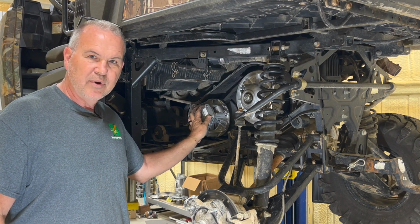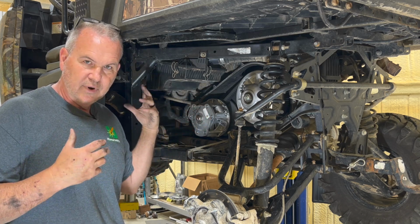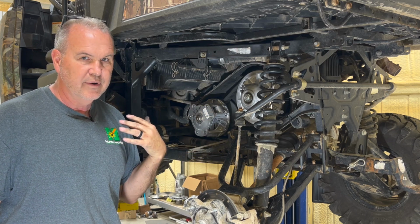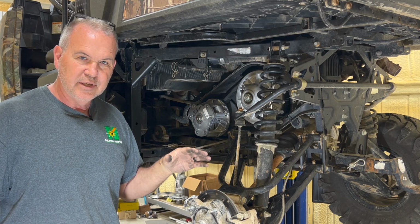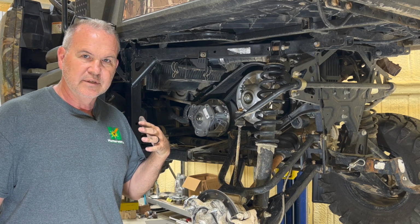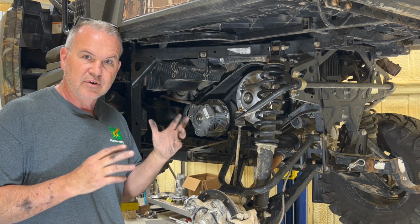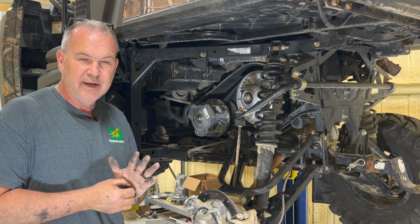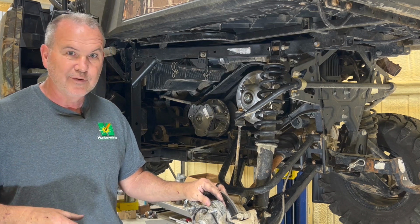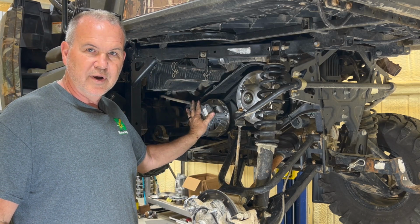Now inside our primary clutch is going to be stock Ranger 1000 weights and a stock primary spring. We're not believers in clutch kits for Rangers as a general rule. The customer we're after is somebody who has a stock or near stock and uses their Ranger as a Ranger. So you big tire guys, you're flying around like razors, not necessarily applicable, or you have to work with you on it. So it is a new Hunterworks primary.